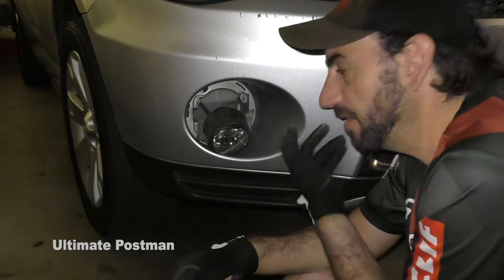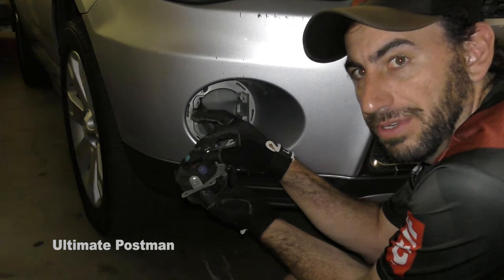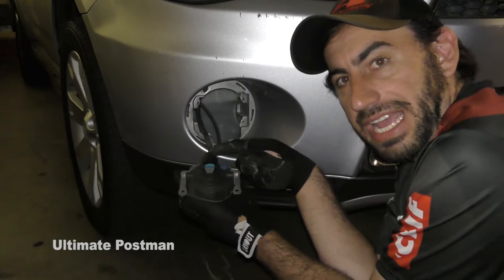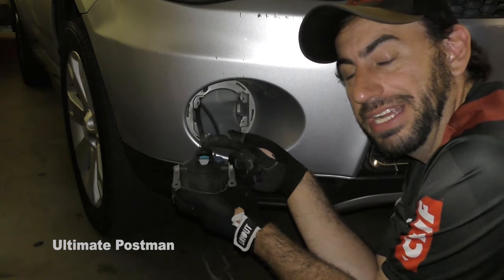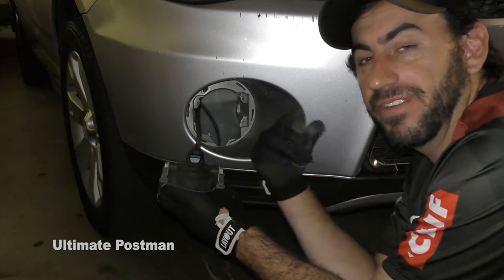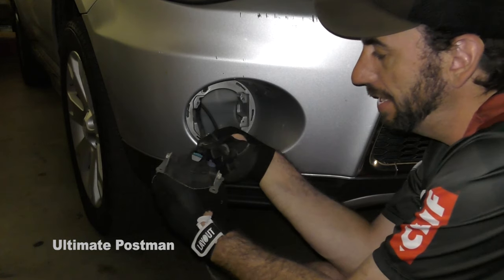This will come out — just be careful, the cable is connected to the back end. There's a tab on this side. You're going to push the tab in and carefully pull the cables out. You don't want to damage these cables. It's very expensive to get this wiring repaired — on my 2003 Eclipse, the wiring harness for the front is like a $1,400 repair. Just be careful when you're doing it. Push the clip in and pull out.